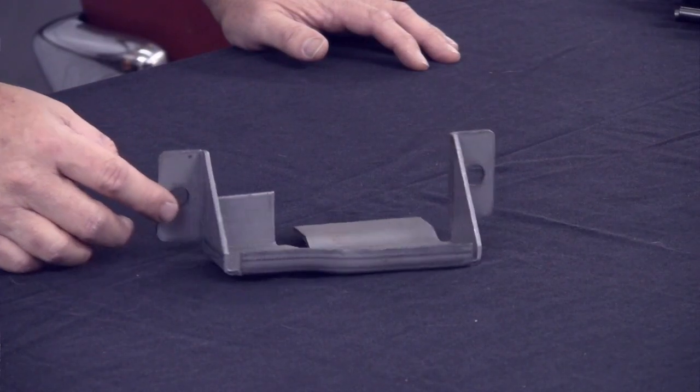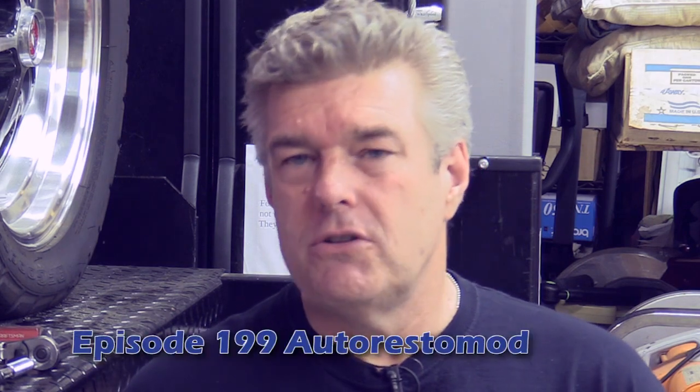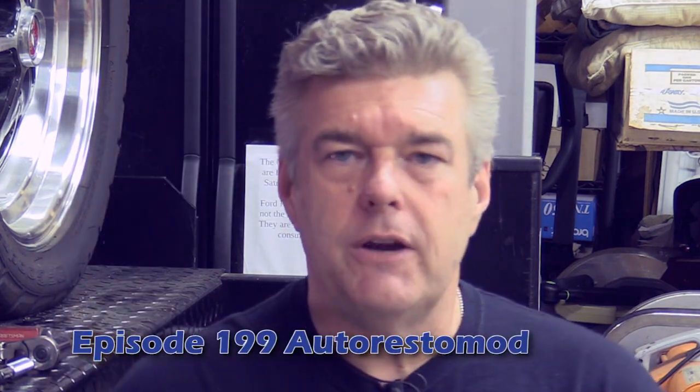You may end up having to do what we've done to this car: go in and put in the 1970 Mustang sway bar mounts. Those mounts are beefier and bigger, and they're a pseudo close match. We did a video on doing the sway bar mounts — I'll put the link in the description below. If you want to see what we did to modify the '69 Fairlane so we could run that big front sway bar, check that out. Now, make sure the front end on your car is in really good condition. Any blow holes people have put in the shock tower to grease the upper control arm bushings is bad juju because it weakens the shock tower.